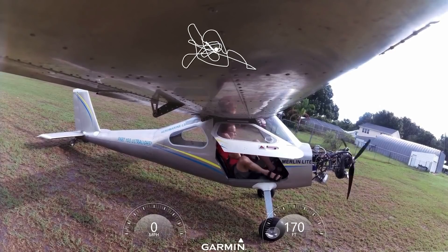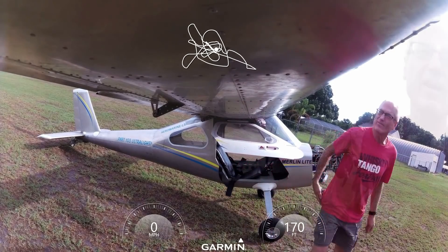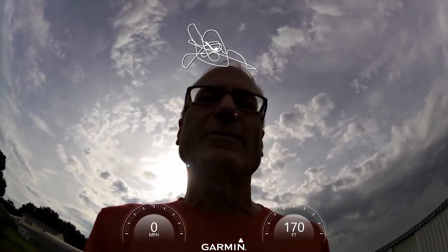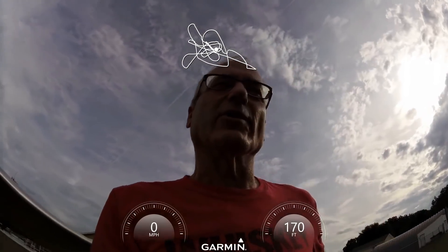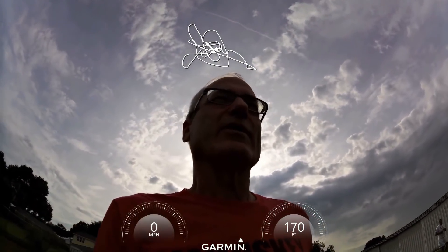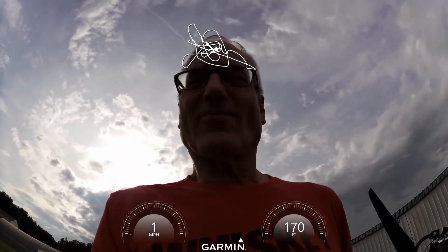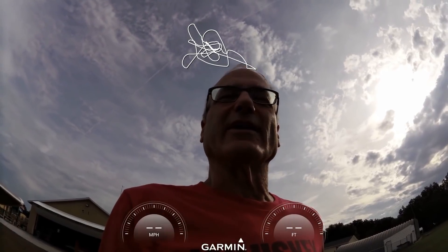Well, that was an enjoyable flight right before the lines of thunderstorms came in. I did some video with my phone in the cockpit to record the temperatures, RPMs, speeds, some turns and roll rates, and some general climbs and cruises. Stats were pretty good — I was getting over 600 feet per minute climb with flaps in, and 500 without. Then a cruise of pretty much what I had before. The prop is a little bit coarser pitch than I had, and I think it would be a little better climb if I made the pitch a little bit finer and I'd still get the same cruise.